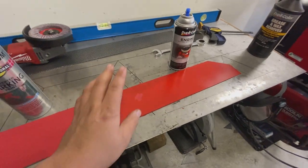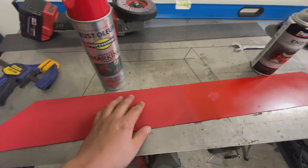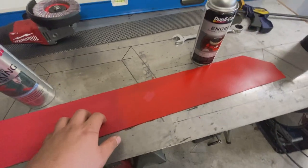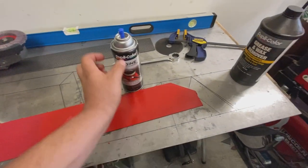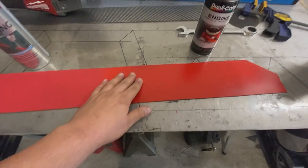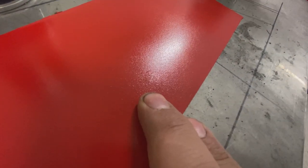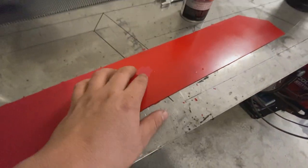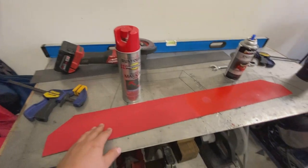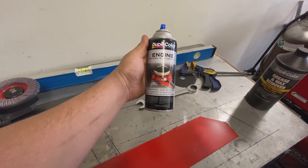It was so cold last night that after I had sprayed this it kind of looked dry already, so I went ahead and did the second half with the Duplicolor red - and that's why I got this kind of stuff peeling right here and a fingerprint right there. That was just because I didn't let the first coat of Rust-Oleum fully dry. So it looks like I'm going to end up going with the Duplicolor instead over the notch. But with it being as cold as it is, I'm surprised this even dried.